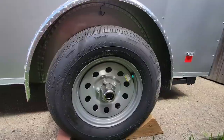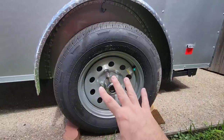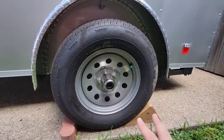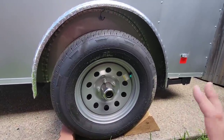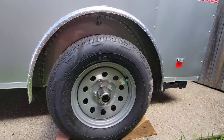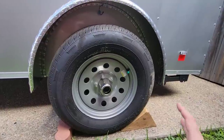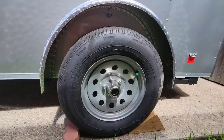The Trans Eagle tires that I'm putting on have already come in; I just haven't gotten the wheels yet. They'll be replacing this setup — these are ST205 75R15 Rainier tires, C load range, six-ply rating. They're not designed to be a very heavy-duty tire but most people are pretty happy with them. We've towed a bit so far and you can definitely tell these are softer tires, so they do add to the suspension of the trailer — the sidewall acts as a giant airbag.